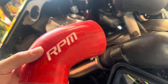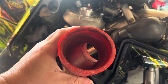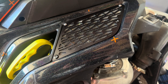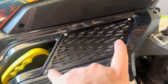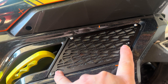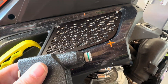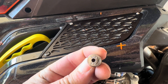I already had the clamps taken off. I did get this RPM heavy silicone one so the intake tube on top of the turbo doesn't collapse under high boost applications. Then you install the housing with the rivets — this location is going to be a 3/16th rivet using the two original factory holes where there was a metal nut ring on the back that you had to pry off. The two holes over here you're gonna have to drill with a 1/8th drill bit, then transition to a 1/8th rivet from the 3/16th rivet.